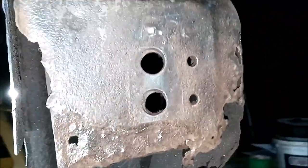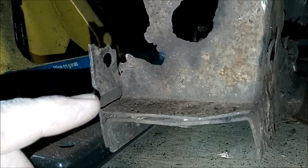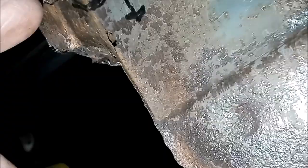And I measured it from there, 12 inch, all the way down to the bottom of this piece right here. So that seam is all the same seam that needs to attach back up to this seam right here. So what I've done is I've marked it at 12 inch and I've cut it into the metal.